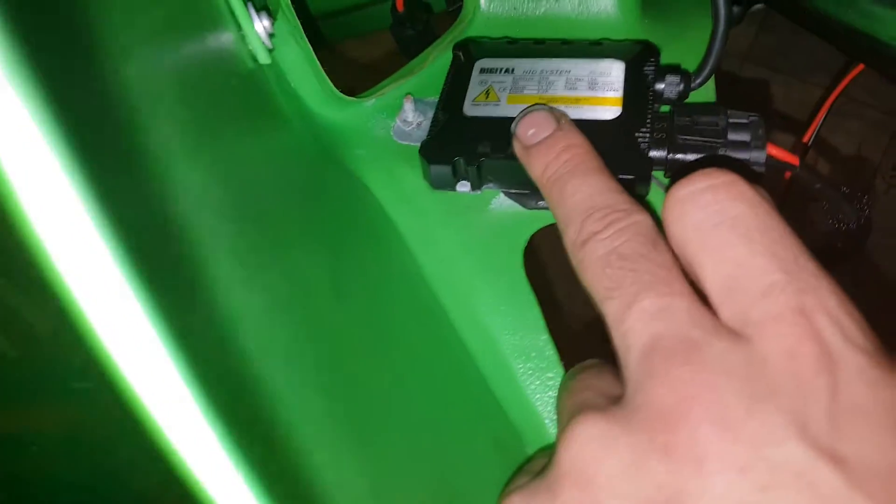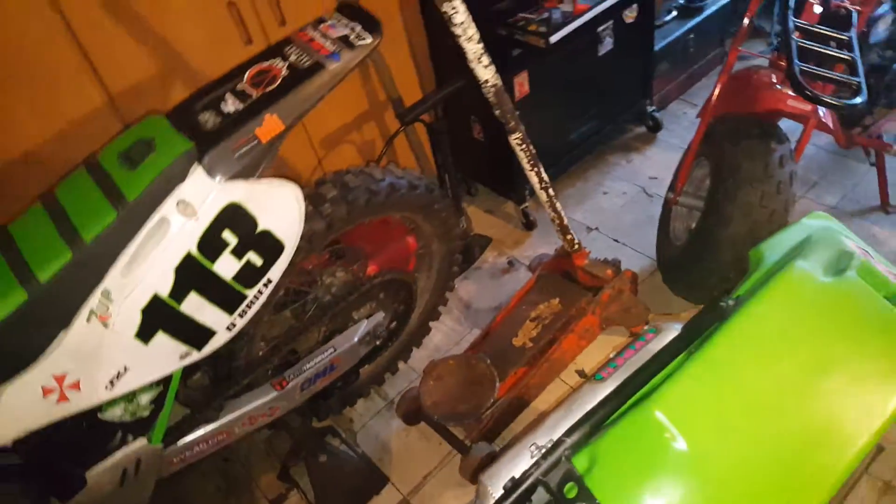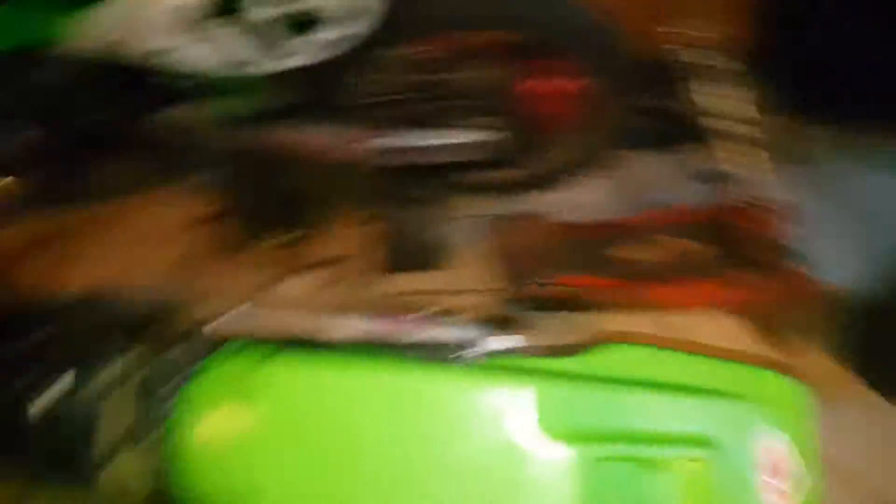That's not per hour — that would be working DC on full throttle the whole time, which would be the max. Off full throttle it would be about 6 amps. I'm putting in HID for the front headlight and LEDs for the rear tail light, which are going to be in two completely separate circuits so there's no interference, flickering, or EMF for the 12-volt LED rear tail light.